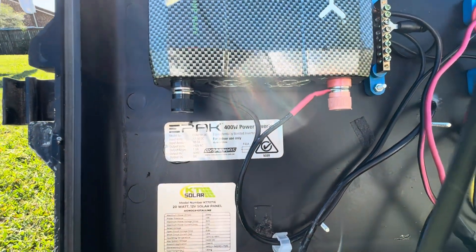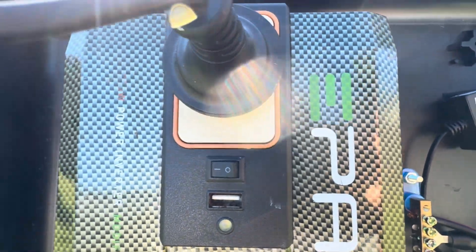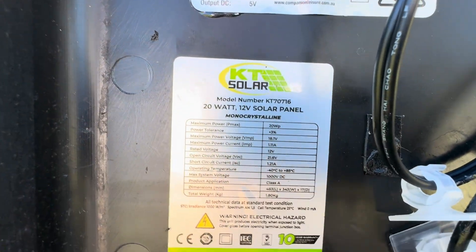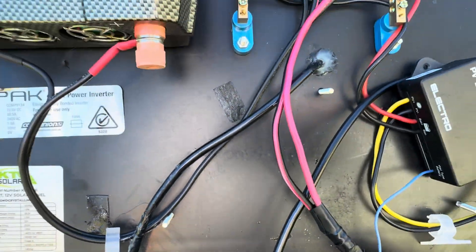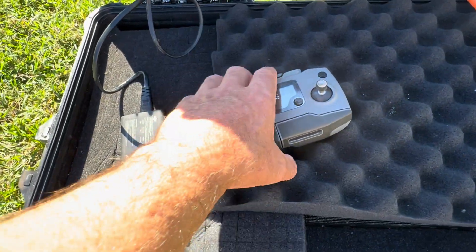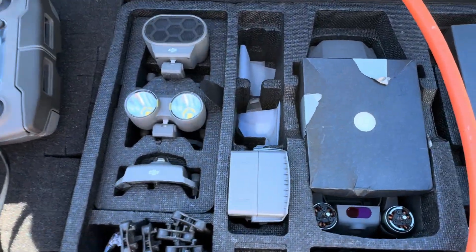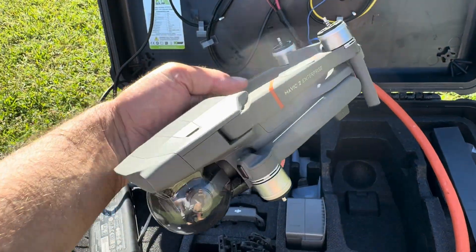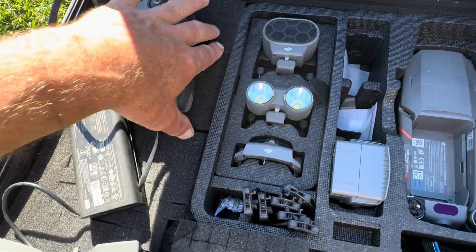From those bars it runs back from a 12-volt power supply to the 240-volt inverter. For those unaware, a 240-volt inverter inverts the power supply from 12 volts up to 240 volts. The sticker above it was incorrect — I used to have a 400-watt inverter and I've since replaced it with a larger 700-watt inverter. You can draw up to 700 watts from this machine, though it's only suited to low-power devices such as phones, drones, LED lights, and small 12-volt fans.